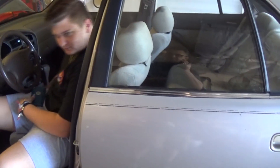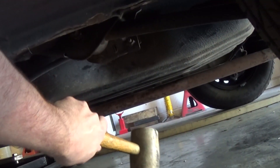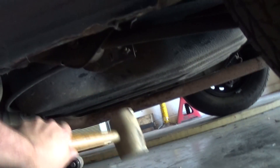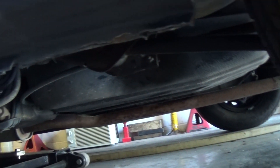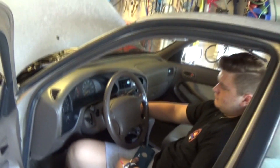This is the key now - as you're cranking the engine over, we're going to hit the fuel tank to wake up the fuel pump. I'm going to locate the tank and hit it while you're cranking. Go ahead and crank it now.